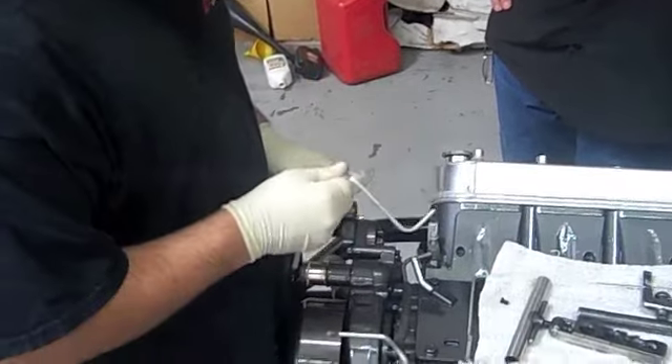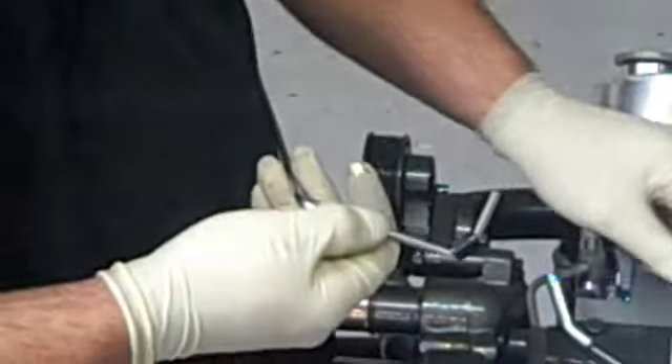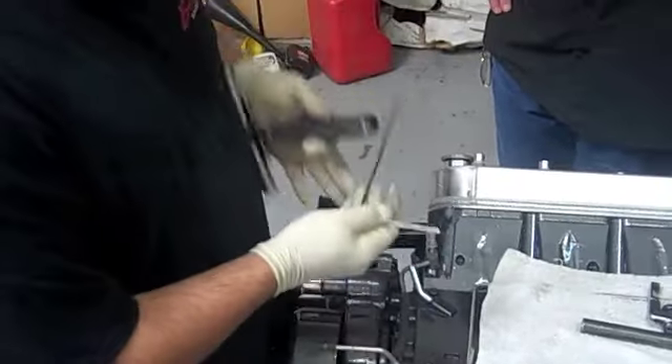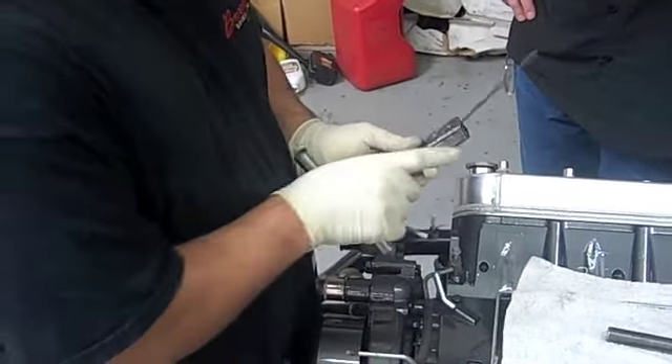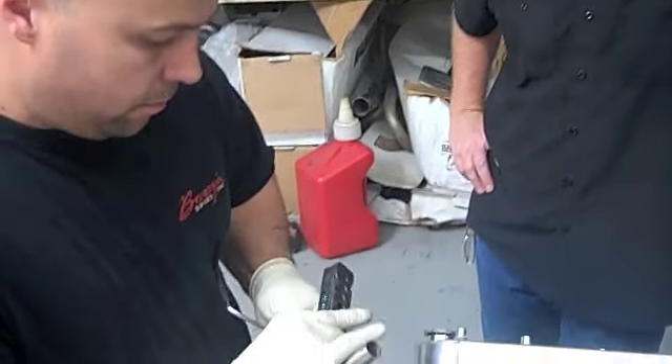The lines have already been bent. The key is to make sure the nut goes on before the sleeve — we all make mistakes. You get caught up in what you're doing and it's pretty simple to forget one or the other. Always keep your head in the game when it comes to brake lines.